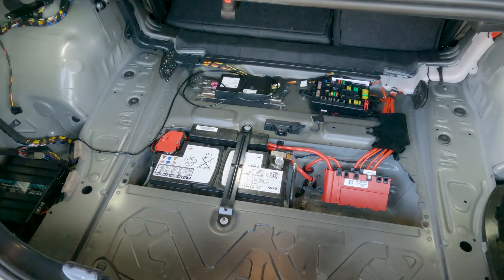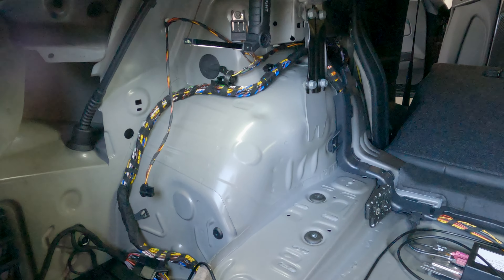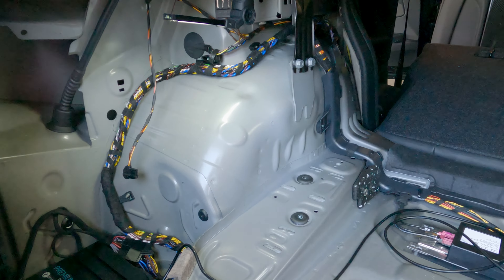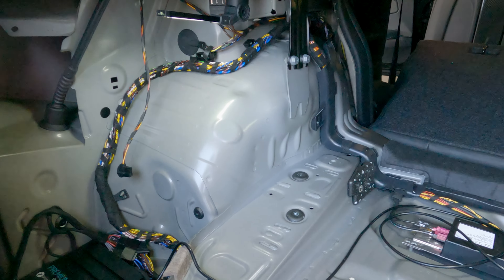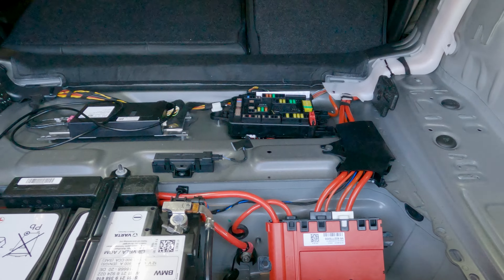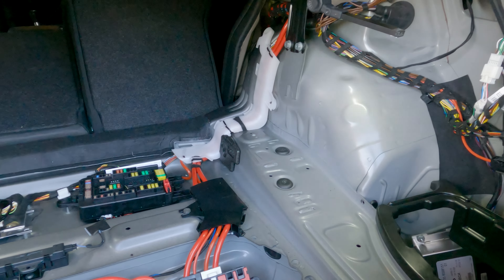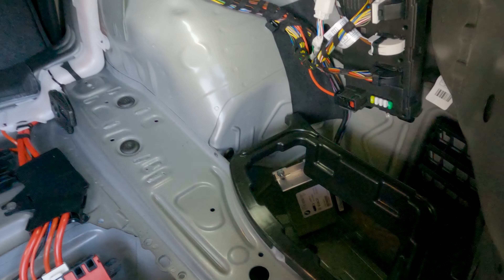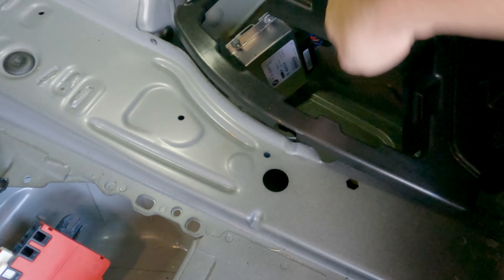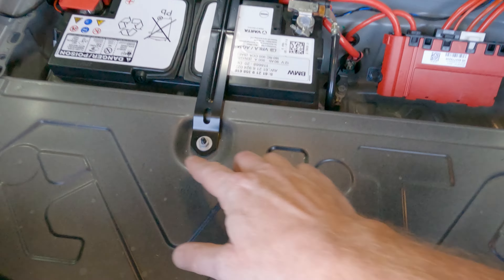All the carpet's out, and I'm really excited about this — it's going to go really easy and simple. These are really not complex spaces to cover. In the M2 case, I would take all the carpet out because it gives you the ability to work much more cleanly on some of these exposed edges. Now all you need to do is start laying out and measuring out sound skins. I'll probably start here on the back plate just to show you. Make sure that you measure cleanly. I always install the sound skins with the logos in the same direction. I'm also going to get my shop vac and take out any dust and debris first.